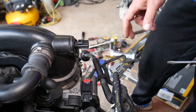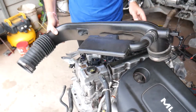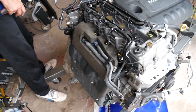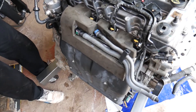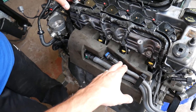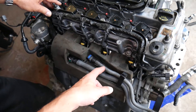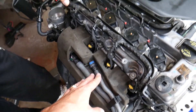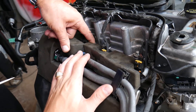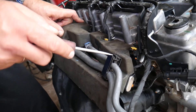Remove that from there. Next, things get dangerous — you have to disconnect your fuel line. The fuel line is under pressure; when you disconnect it, it will spray fuel everywhere. It can get in your eyes, so wear eye protection and gloves. Do this only on a cold engine. No open flame, no spark, no smoking, because that fuel can catch fire. Have a fire extinguisher ready.